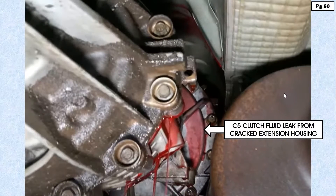This actually resulted in a three-fourth delay and a bang at the fourth. Basically what it was is a low fluid condition that resulted from this leak in the extension housing — the extension housing cracked. You could see we have this running, you could see the fluid pouring out of there. That's a pretty bad leak and that's C5 fluid leaking there, so the end result was the three-fourth delay and bang at the fourth due to this leak.